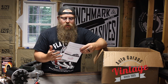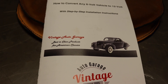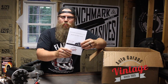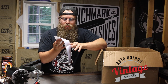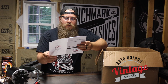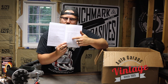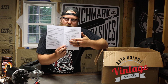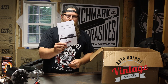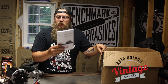Now here's something that's really nice — what is a good kit without some good instructions? This is how to go from 6 volts to 12 volts. In the next video I'm actually going to show you how we install all this onto a fire truck. What we have here is a basic guidance and manual — it shows you a lot of great information including wiring diagrams in the back for how you should wire up your starter, alternator, ignition, and all that. Another really good resource inside this book is a chart showing which 6 volt bulbs you had, with all the different part numbers, and a conversion chart showing what that 6 volt bulb is as a 12 volt bulb. So this is what you have, and this is what you need now. You can buy these books standalone — pick one up and read through it before you get the kit, it will give you a lot of good information before you get started.